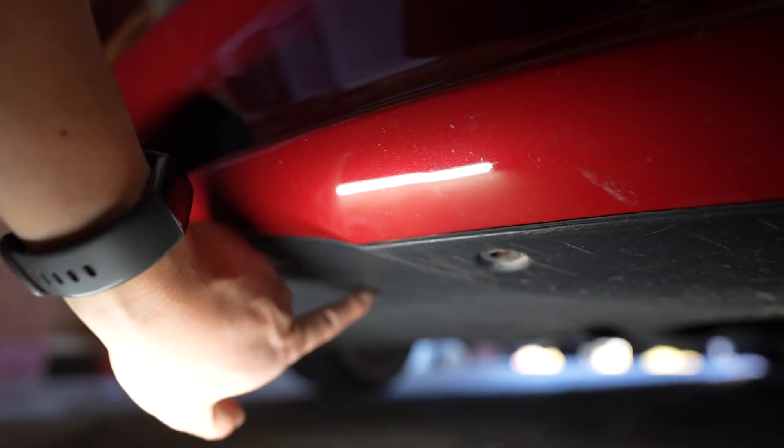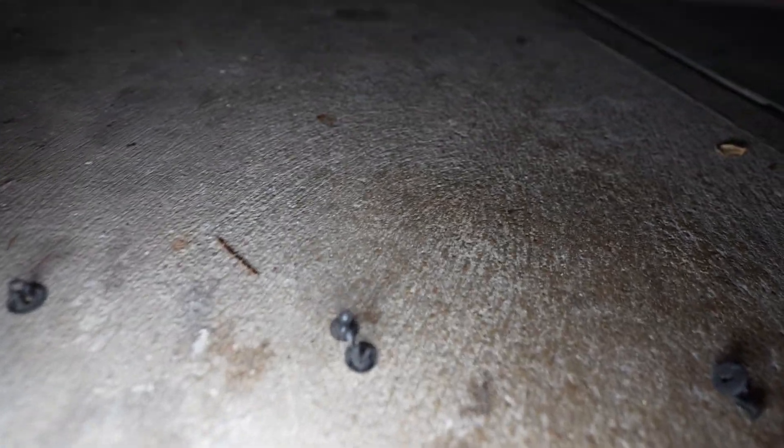There are 10 clips in total. Those clips hold this bottom aero shield — I think that's what it's called — to the bottom of the bumper. They're kind of two-piece clips: there's a center portion which goes inside the bottom portion, making it fatter so it stays in place. You want to remove the center part, and then the bottom part just comes out. For me there were two different types of clips — the majority were one style, and then randomly there was a different style in the middle.